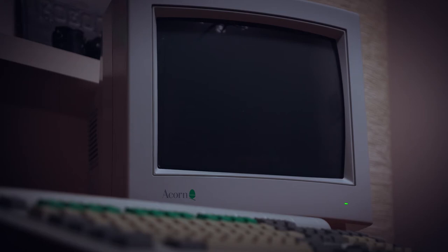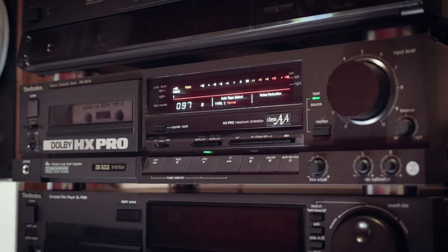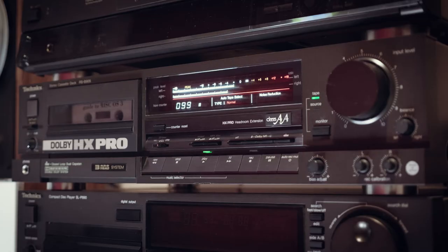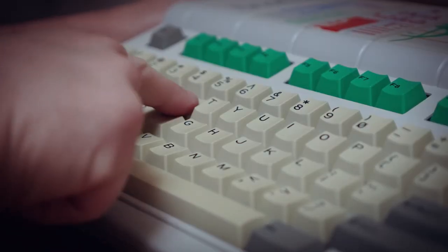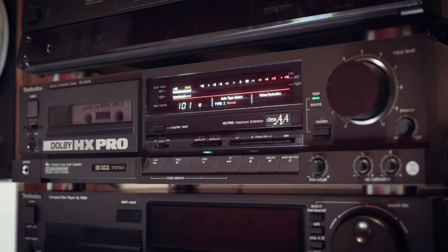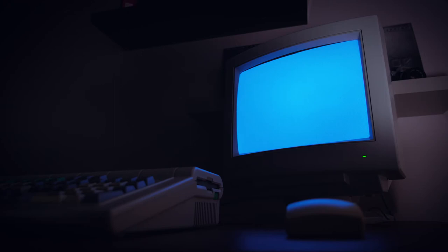So our A3010 has passed the power-on test, but I'm not really sure what to do here — I was hoping to see the familiar-looking RISC-OS. Maybe our Acorn guide can help us out. First, switch on your monitor. And then hold down the letter R on your keyboard, and still keeping it held down, switch on the computer itself. When it's switched on in this way, the computer goes through a set of checks and resets itself to its factory settings.